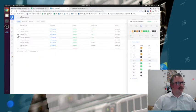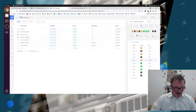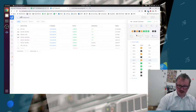If you have a look over here on my Unifi controller, the camera that I was just waving at is plugged into port 5, and you can see that that's on VLAN 400, so that's on the same VLAN as the Dream Machine. The Dream Machine's down in the cave downstairs. I'm about to plug the viewport into port 2. So I will do that and we'll see what happens. Hopefully it shows up in the UDM Pro as needing adopting.